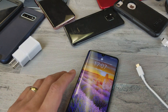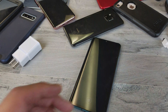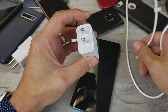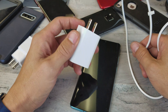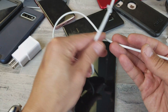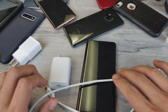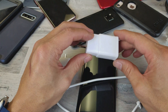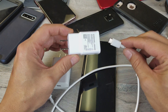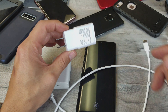In case you're not able to get that double lightning for quick charge, let's go over some troubleshooting tips. First thing is this: you need to have the correct wall adapter brick — at least a Qualcomm 3.0. Also, you need the correct cable. I tried to charge this Huawei with a Samsung adaptive fast charging, but I think that's only Qualcomm 2.0 — and even with the correct cable, it still does not give me the double lightning on the P30 Pro.